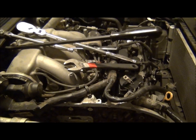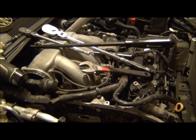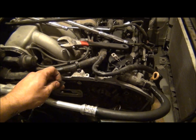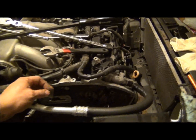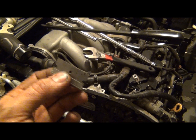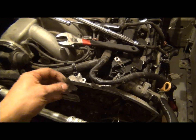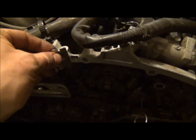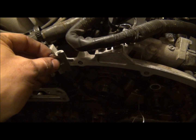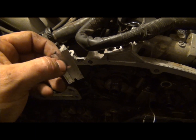First one I'm going to show you, I want you to be very, very careful with, because if you use this and you don't know how to use it, you will gash the mating surface and you will ruin it. This is mostly aluminum stuff you're going to be working with, especially dealing with oil or coolant. Most of the stuff's aluminum these days. The aluminum is very soft and this will cut it. You can cut aluminum with a razor blade. If you're going to lay it on the edge, at an angle like that, and try to scrape stuff off, I urge you to be very careful, and if you feel resistance, you stop. Okay? If it gets dull or dirty, clean it off or throw it away and get a new one.